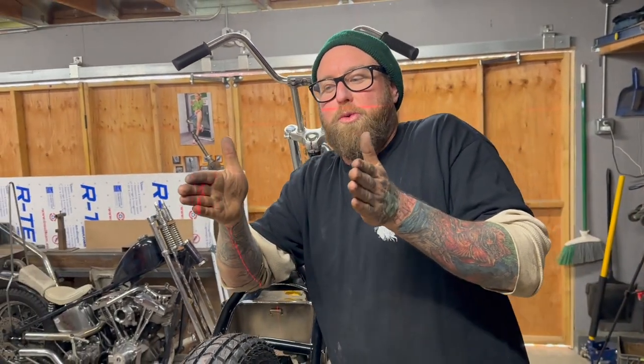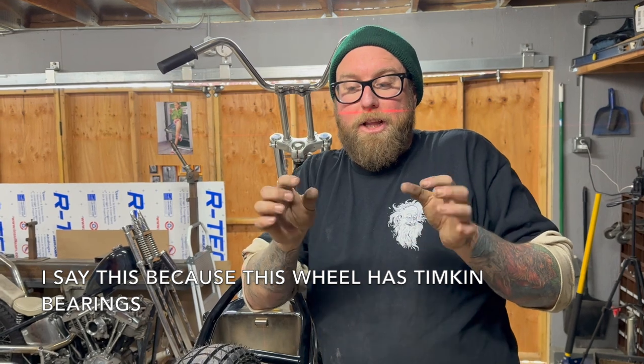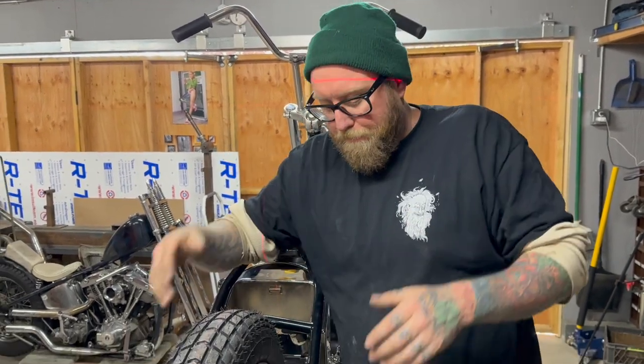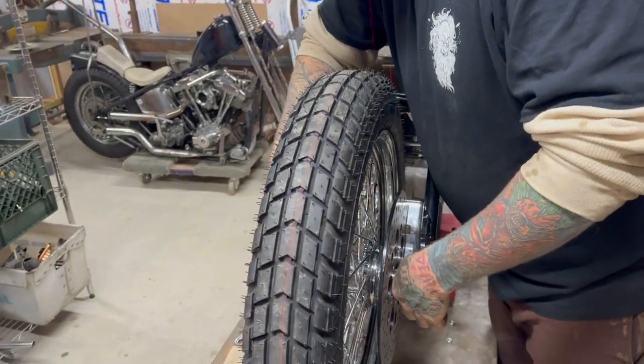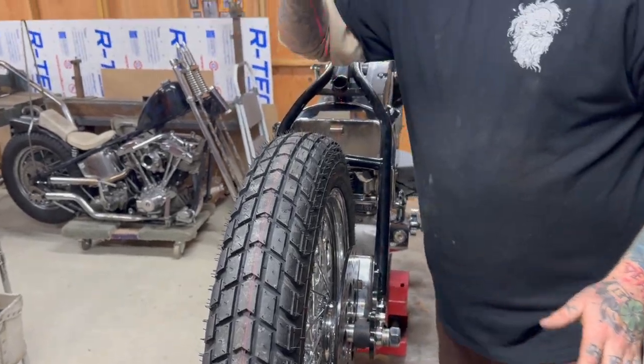You can still squish the frame a little bit, and when it goes to set it's going to set everybody up real nice and tight. But make sure initially that you've already got everybody pushed pretty tight, so that you don't make a measurement, and then when you go to tighten the wheel, it was actually too short and it just pinches in on itself. So those are feeling pretty good. That's good.